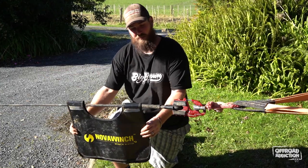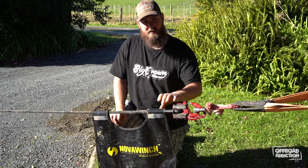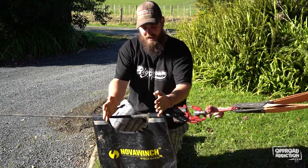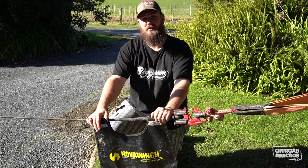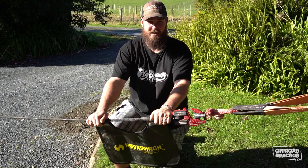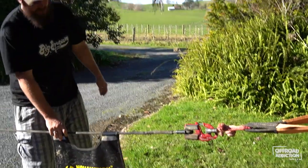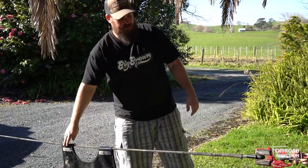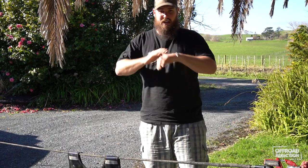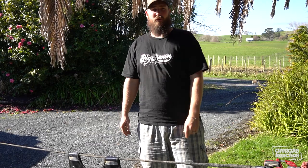So you put the cable dampener on, and a lot of guys in competition, you'll see they will cable tie it to their hook at this end. And that generally means that it's just going to take it to the ground if it breaks at this end. Now those guys are trying to do a lot of crazy different things, and in general everyday wheeling, you're probably not going to put your vehicle through the same forces as those guys do. So what we want to see you guys doing is using winch dampeners, and sticking them out on the first third of the rope so that if you have an equipment failure, it takes it to the ground and keeps everyone safe and gets everyone home, because that is what we want at the end of the day.